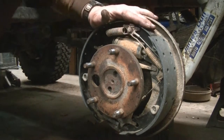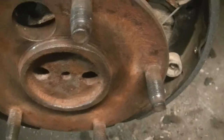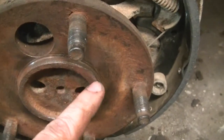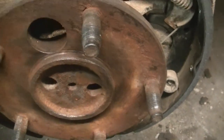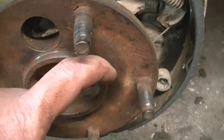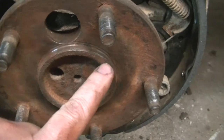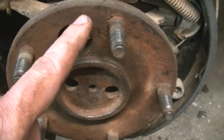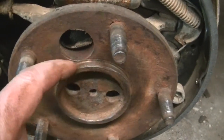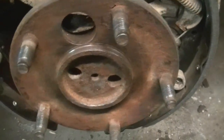Once you've reached this point, you're all done — all you need to do is adjust your self-adjuster. A couple of quick things to note: if you're having trouble getting your drum off, make sure you don't hit right here with the hammer. This is a junkyard axle shaft that I put in, and you can see somebody wailed it right there, so my brake drum is not fitting over very good because it's mushroomed out — you want to avoid that. Also, when you're putting it back together, it's probably a good idea to clean this up and maybe put a little bit of anti-seize right around the edge here. I'm going to go ahead and deburr this now.